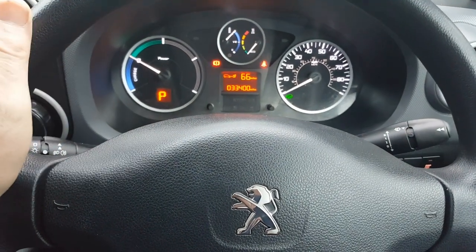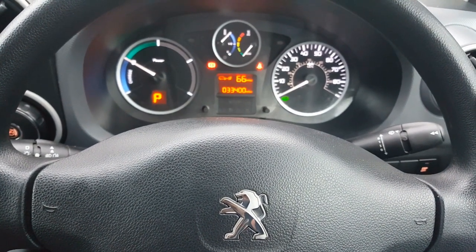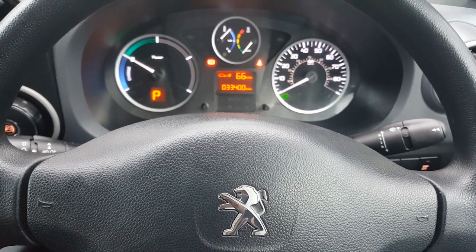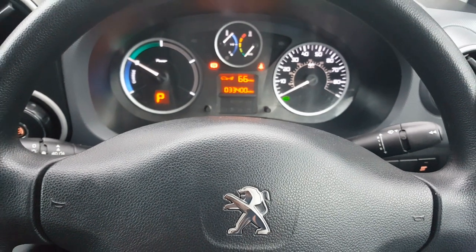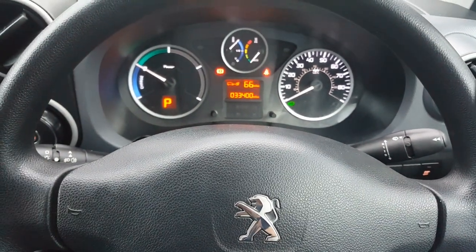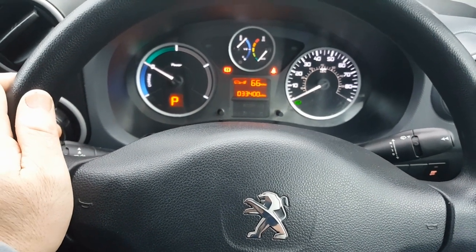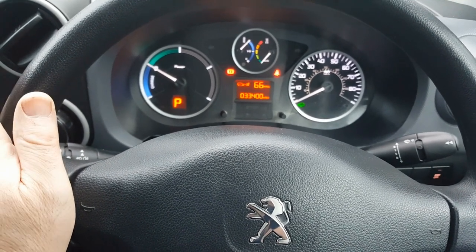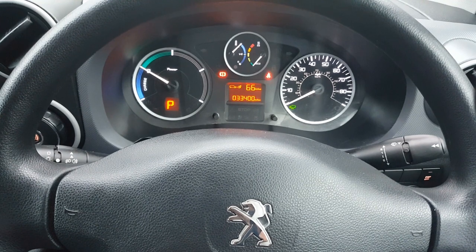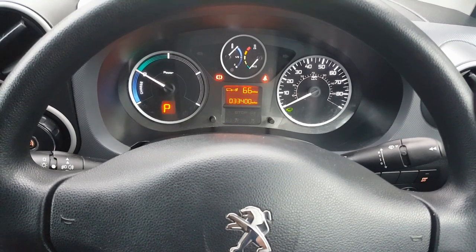You do find with electric vans that because of the heavy regen and infrequent brake use, the brake discs corrode. When you do use them they can be quite noisy. If the van has sat for a few days, particularly after rain, the discs corrode and you'll hear the brake pads rub — but that's completely normal. You can get up some speed and apply the brakes to clean the discs a bit. A bit of corrosion is no harm, but it's worth knowing you'll hear the brakes grinding on an electric van, and there's no engine noise to drown it out.